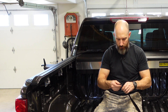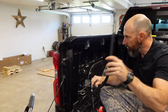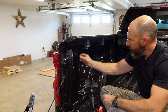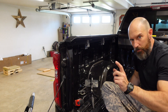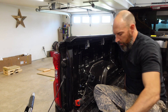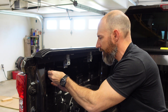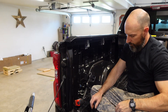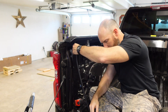Now both sides of your rail will have a spot right here at the back to put these smaller tubes on. Then you're supposed to run this out through a hole. At least on this Chevy, I have a nice hole right here and it's great that this little rubber grommet is gonna fit right in there. You gotta put this rubber grommet in because if not, that tube's just gonna wear a hole in it. Put the hose clamp on there, stick that in there, and then tighten that up with the screwdriver.